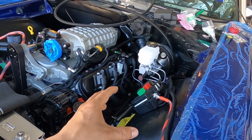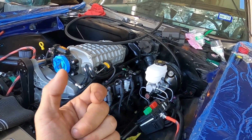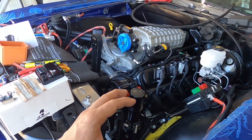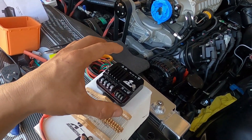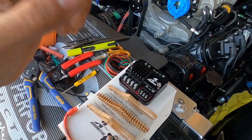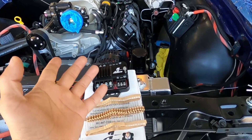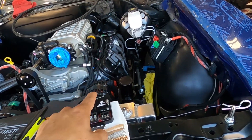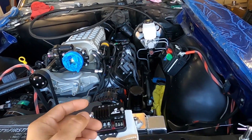In the long term, this really helps preserve the pump and other electronic devices like fans. If you're running that pump 24/7 at 12 volts all the time while driving, you're really just heating it up to its full max constantly. Running a fuel pump controller limits the voltage when you're just cruising, and it really comes down to RPMs. If you're on the highway cruising at maybe 2,500–2,800 RPM, there's no need to have that fuel pump screaming and pushing all this fuel to the motor.